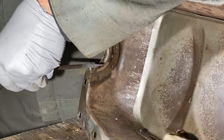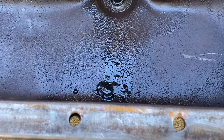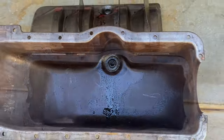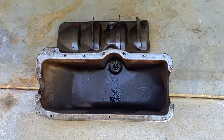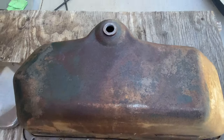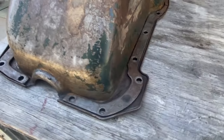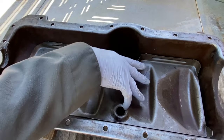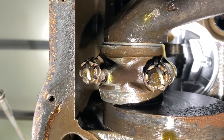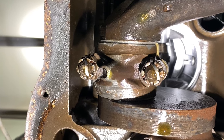Here's the rehab of the pan. You've got to get that rope seal out — that's the crankshaft seal on the front. This was really the extent of the debris and gunk in the pan, which was pretty impressive. Here's the pan itself, and there's the dipper tray. You see those basins — those are for oil. The oil dippers on the crankshaft pick up oil from there, because this is a non-pressurized oiling system.